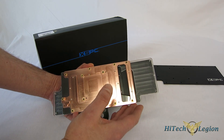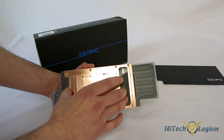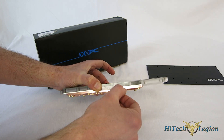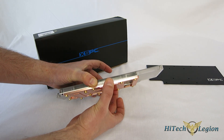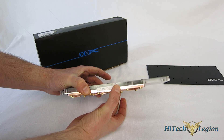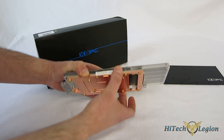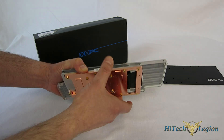You are going to get advanced VRM cooling from the liquid itself. On the back of the all-copper contact plate is a stainless steel plate, so it's not relying on the acrylic to make a seal — it's a fully sealed unit. This gives you more stability and more reliability. No worries about the acrylic bending, warping, or causing a leak. So you've got a nice, solid, sealed unit here with no worries as far as leaks go.